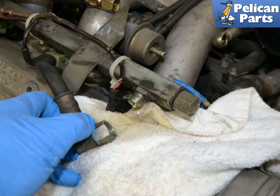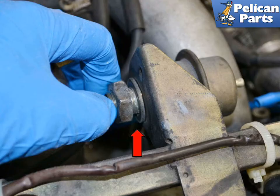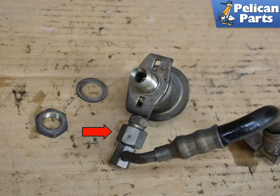Supporting the dampener, remove the 24mm nut and washer holding the dampener to the bracket. With the line and the dampener removed, you can move the line to the new dampener. From there, installation is the reverse of removal.